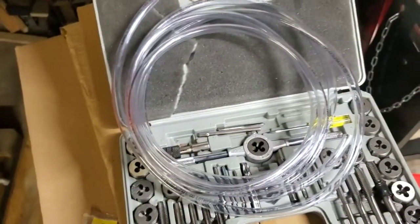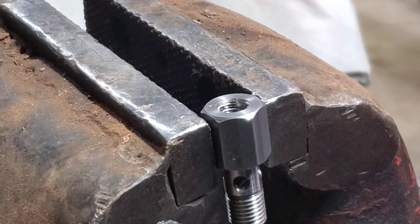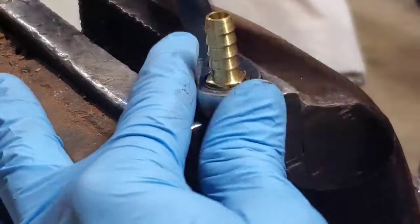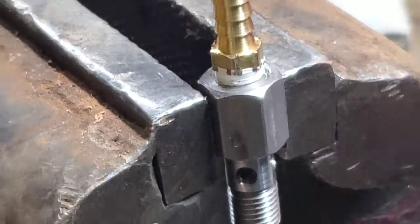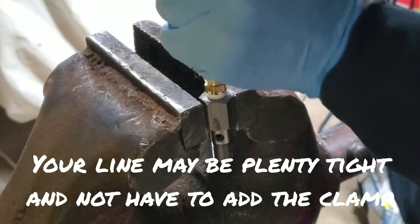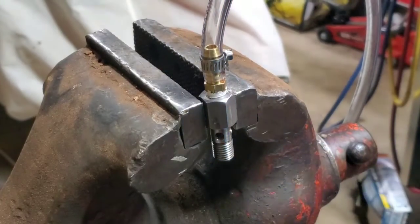There is a specific tool you can buy — Rotunda and a couple of other brands make one — but if you just want to make it yourself it's really simple. I set it in a vice, get the little fitting, put some thread tape on it, thread it in, and snug it down. Then take your hose clamp, put your plastic line on it, push it down around that, and get your band clamp on there.